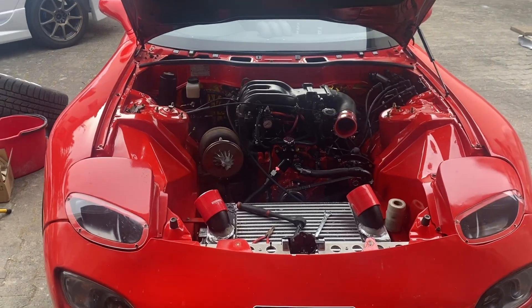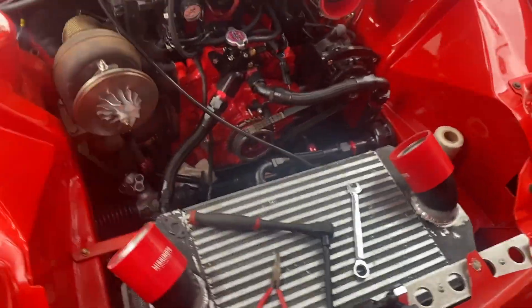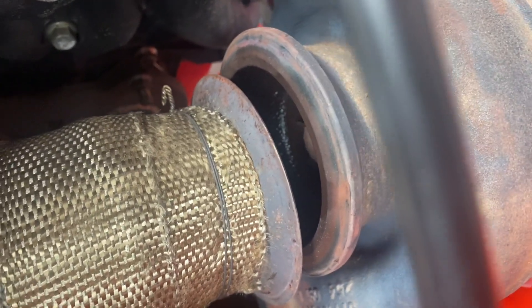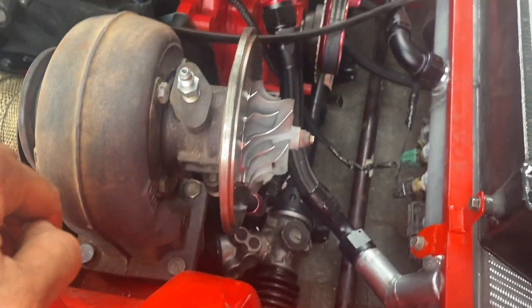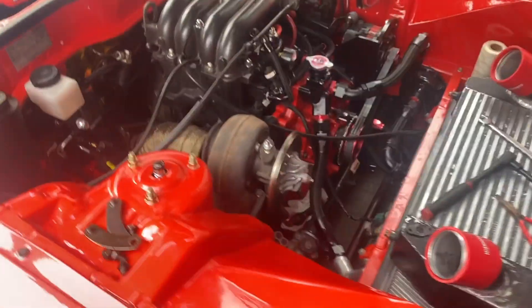It's the next day. I got the exhaust taken off and the turbo blanket taken off. I can already see there's a bunch of oil on the exhaust, so that is probably why it was smoking. We're gonna go ahead and zip this thing off and pull out the CHRA and take a look at it.